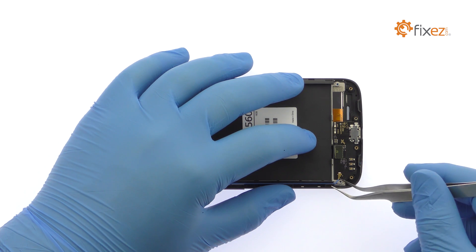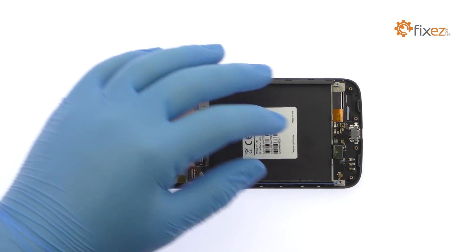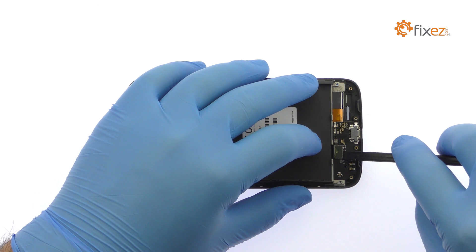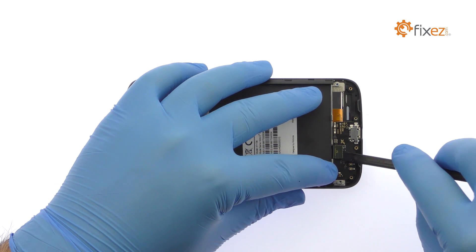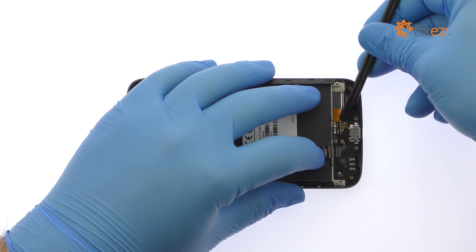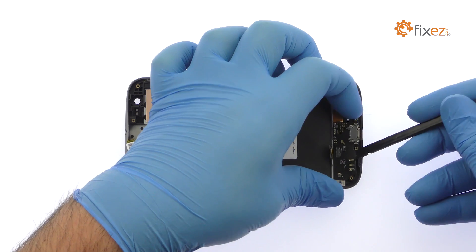Detach and remove the signal cable from the side of the Motorola phone. With the spudger in hand, disconnect the interconnect cable and then spudge up the Moto E3 Power daughter board. It includes the micro USB connector, a microphone, spring contacts, and some control hardware.